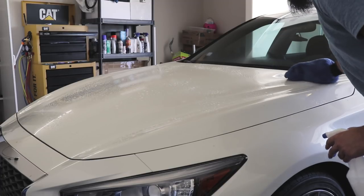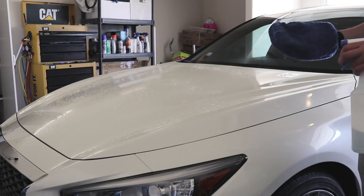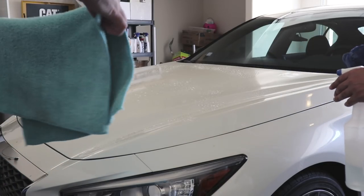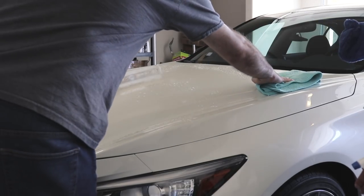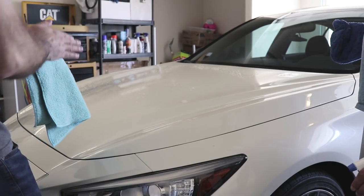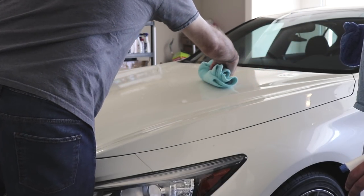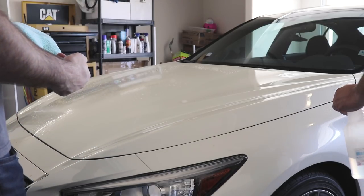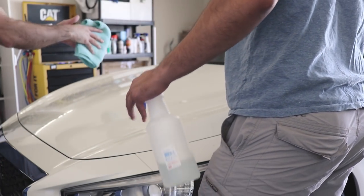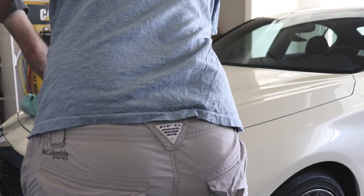As a tip, if you're removing dirt, you're not supposed to rub it in. The proper way is to take a towel, start flat, and then as you're going you roll it up so that you're getting different contact points on the towel. That way you're not embedding the dirt into the paint. If you stay on one contact point you're just engraining the dirt — when you roll, you're literally introducing a new point of the towel every time.